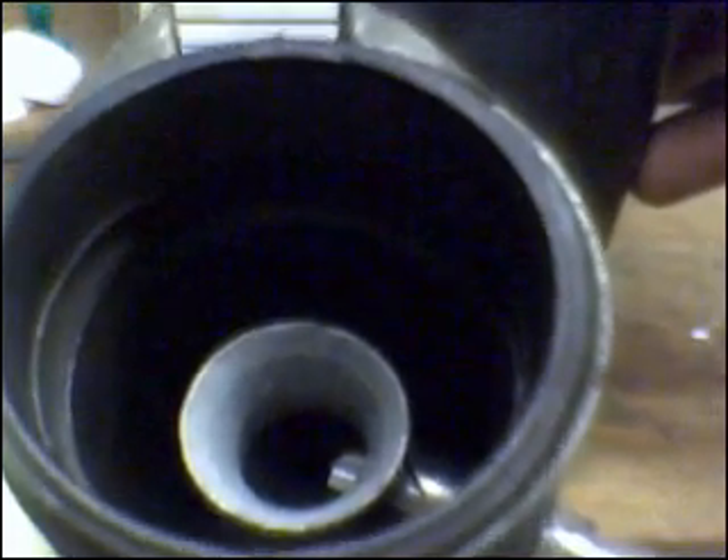Preliminary results with the tube entering the side of the venturi flush to the edge of the venturi — I was able to pull about one inch of mercury at wide open throttle, 6,000 RPM on a four-cylinder 2.2 liter engine. With that little wedge cut, I expect to be able to pull substantially more, and I hope to have some very good numbers for you on that soon.